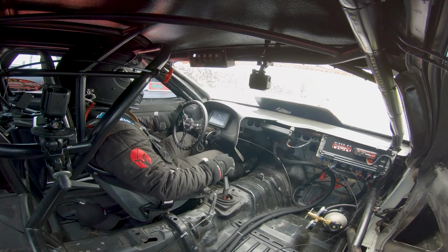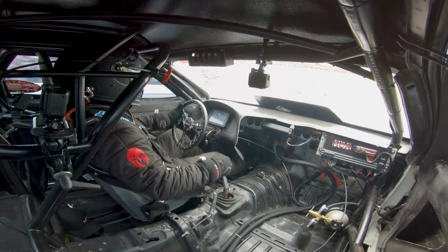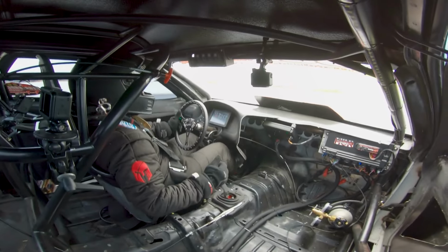So if the fingers push the bearing back off, the next time you go to push the clutch pedal in, it doesn't mean it's going to disengage. Sometimes it will, sometimes it won't. Sometimes you have to pump the pedal depending on how much actual travel your levers have. This can cause staging problems in drag racing. It can cause problems where at the end of the track you're trying to get the car out of gear and you can't because you're having to pump the clutch pedal. I've seen guys doing burnouts and not be able to get it out of gear after doing a burnout because of the clutch itself. And it's very, very prominent in cars that are still using synchronizers with a slipper clutch because they are harder to get out of gear than transmissions with dog ring engagement.